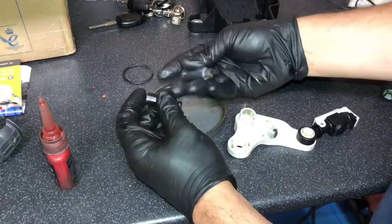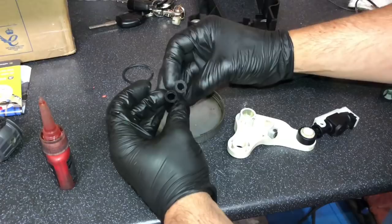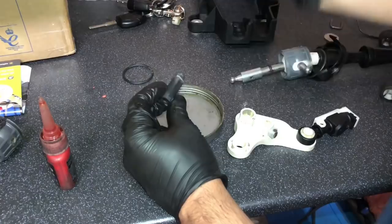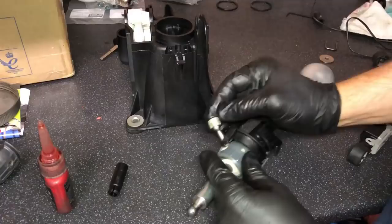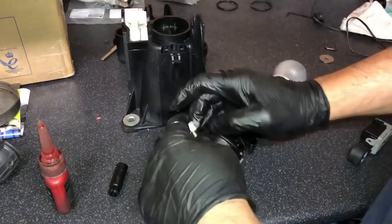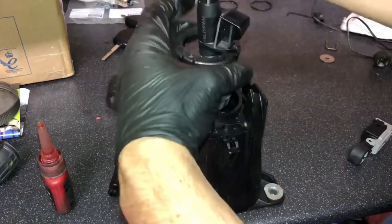For the last bits: go with the plastic pin rather than the aluminium one, because the aluminium will wear away at the plastic housing and then you'll never be able to replace the pin again. You can see there's just a little bit of wear on it — that'll make a couple millimetres difference and give you a little bit of play in the gear stick that you don't want. Slide this section back in, pop it in and leave it loose — don't put the pin in yet. Then re-grease your bush, slot that back over nice and tight — it clicks in — then slot your section in, pull that up, and pop it in like that. Now you're ready to clip it all in.